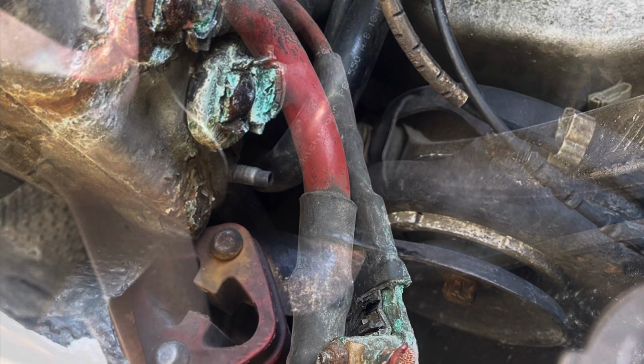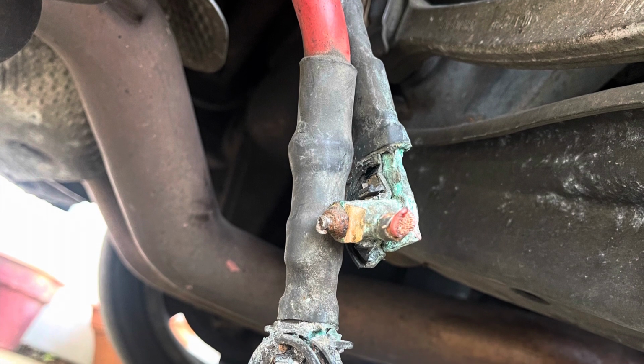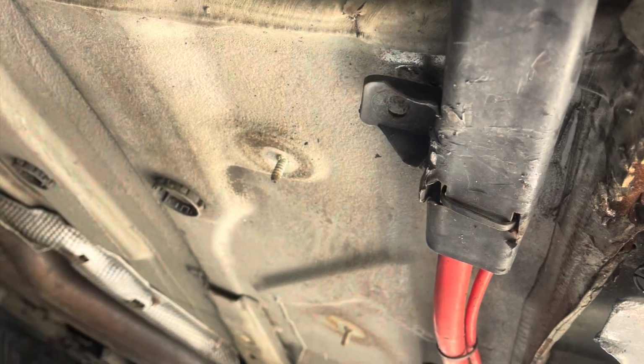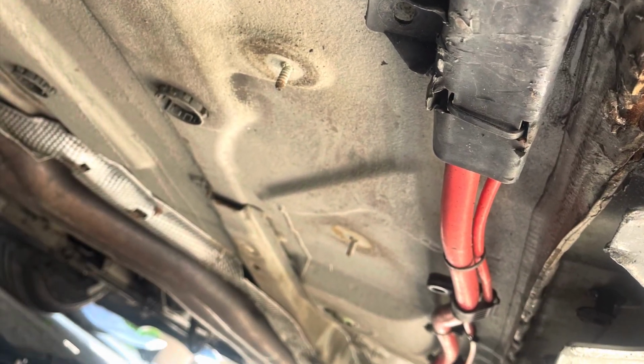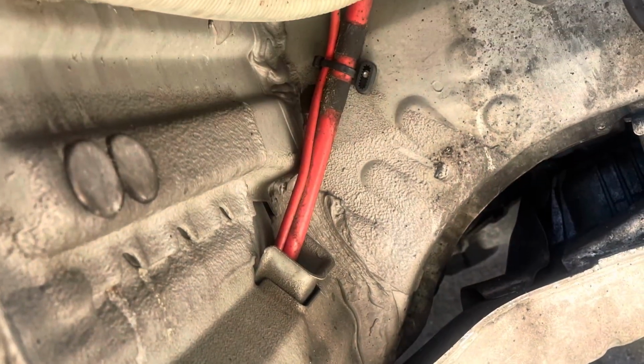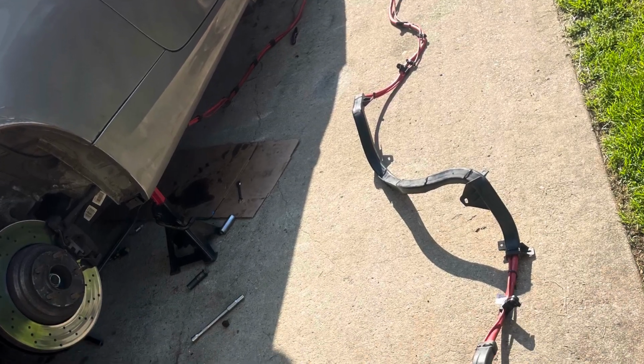So you'll have water coming in, corroding the wires from inside the battery tray. As you can see, my bolt got so corroded that it was stripping, so I had to cut it off. And from the outside, the splash guard where the rear quarter panel is, if that plastic is missing to remove the damage, if you're in the northeast, the salt can corrode. When this problem gets really bad, you can have power voltage codes, and in the worst case scenario, your car probably will not start. No power to the starter.